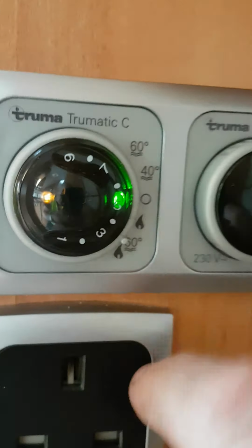So we're just in the wee cupboard here, just below your main wardrobe, and this is your heater. Now the one thing we would definitely recommend is that you don't store anything in here, because there's a lot of wires and pipes, and the heater needs a certain amount of air to actually operate, and there's fans in there that'll suck things in, so I just wouldn't store anything in there at all.